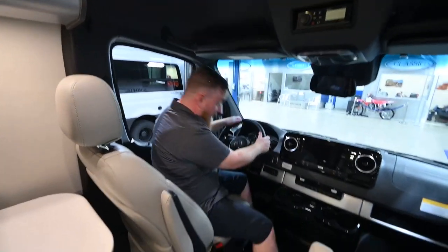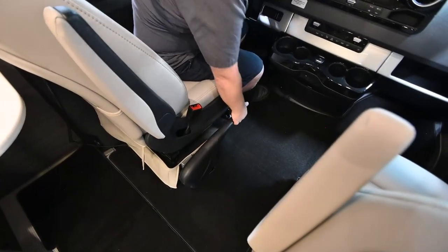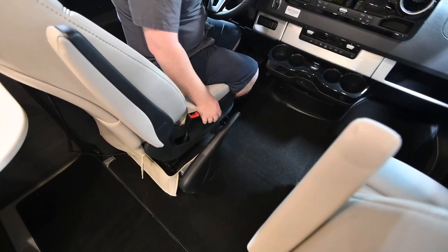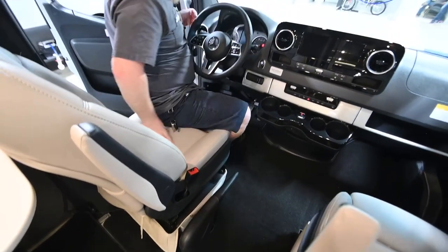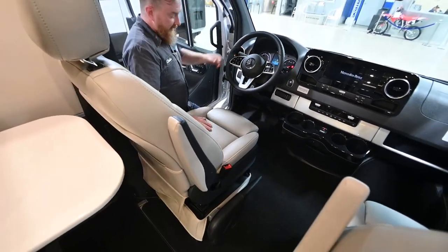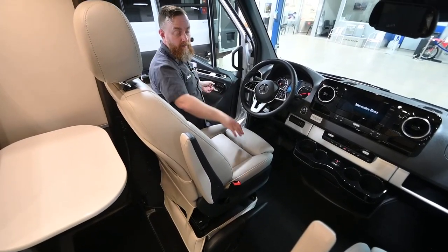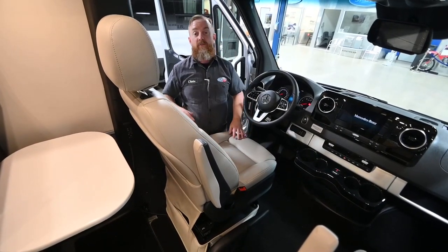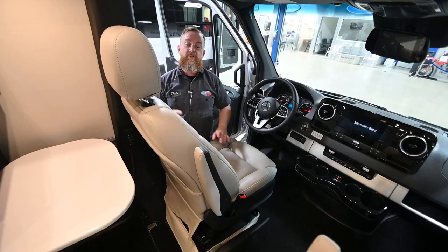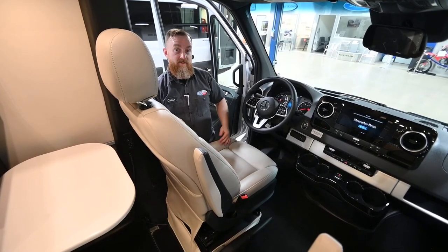Up here in the driver compartment, the first thing is the European style parking brake. European style means you can lift it up to engage the parking brake, push it down with the brake still engaged, and that will allow you to swivel the seat. When you go to swivel the seat, run it forward enough to clear the B pillar. Only turn it 180 degrees — if you turn these seats 360 degrees, you're going to end up pulling the wire that feeds into the airbag loose, triggering a light on the dash.